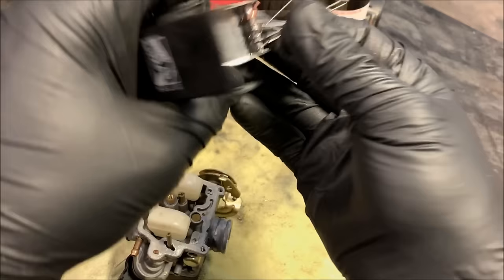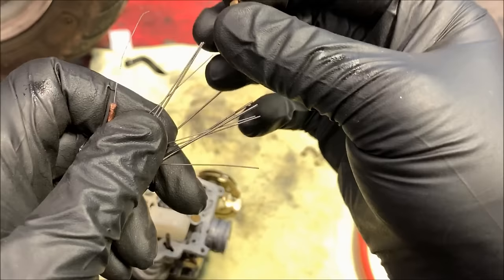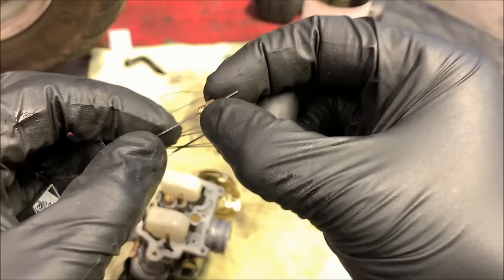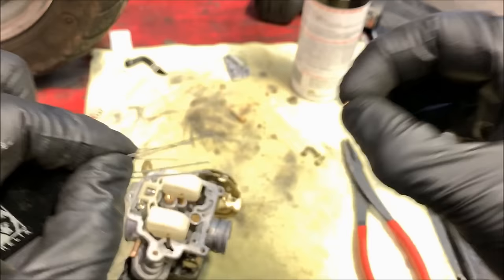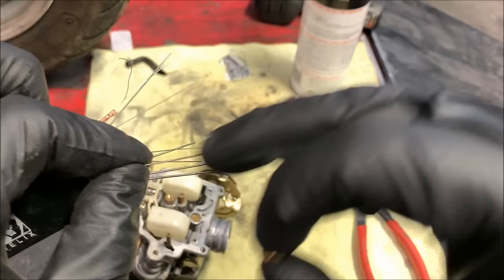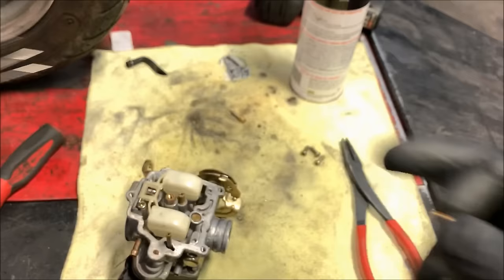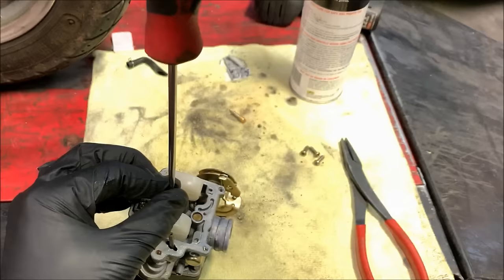With your main jet, even though you can see it's clear, I like to double check. I've had Chinese bikes where it looks clear but actually has a little bit of scale built up, which makes the jet size smaller. You'll go to drive your bike and it'll be running lean and won't like to take full throttle because it's effectively a smaller main jet. Run the poke tool on there. Go ahead and get your main jet back in — with these jets you just need to go snug, not very tight at all. If you go too tight you can actually break the jet since it's sort of cut in half.